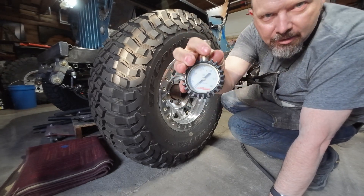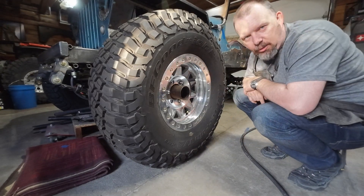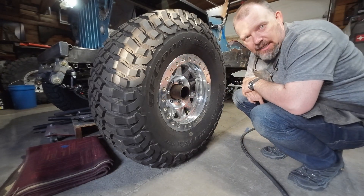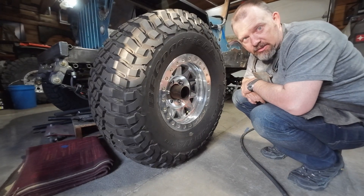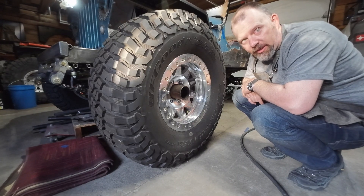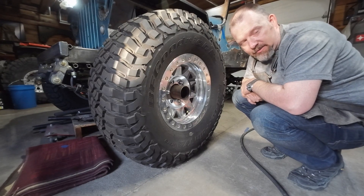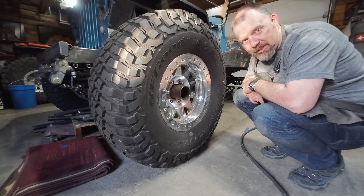It's going down a little bit — that's a little leaky. But it was about 17 or 18 PSI from zero in 20 seconds, so dang near one PSI per second through a standard, small .453 valve stem — a rubber, cheap off-the-shelf, nothing special.